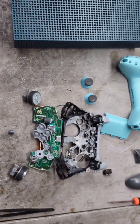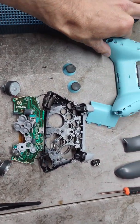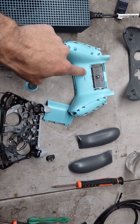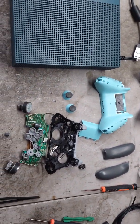That's all there is for this one, though. Just a quick one. Like I said, if your D-pad's not working, maybe that's it. It could be easy. You just got to get the outside of it off, which is just 5 screws. One under the sticker. You can peel the sticker off to not break through, but I just broke through because I'm repairing them. I have a bunch.